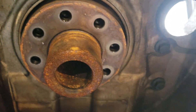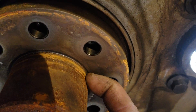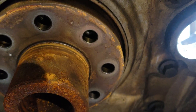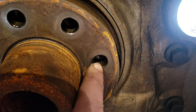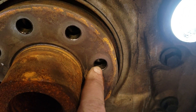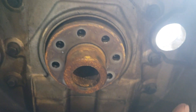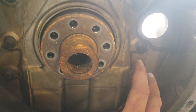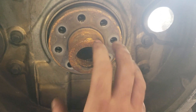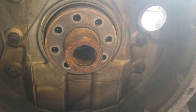I was just turning — I pulled the flywheel off, and that doesn't move. I'm looking in here going, well, that's not an insert. That's actually part of the crank, right? I looked a little closer and I see that these holes are not threaded all the way out. The big issue I thought I was going to have was that I was not going to be able to bolt my standard transmission to this because this snout would not allow the clutch to actually work and fit.